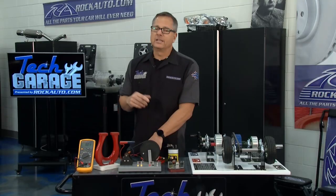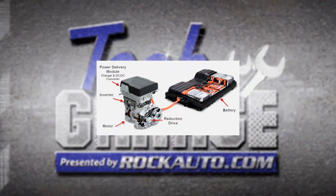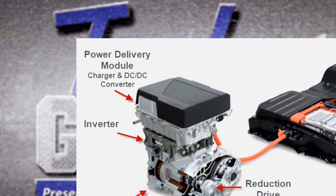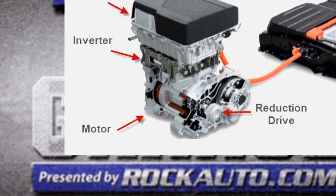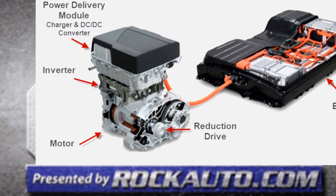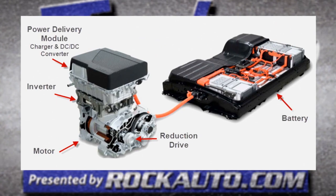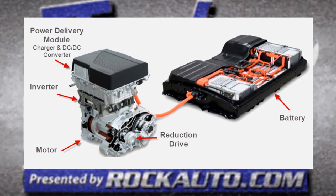Now on our LEAF, it's full electric — and what does that mean? You can see it right here on the graphic. We have a power delivery module on top with a DC charger and a DC-DC converter. We have the charging system up on top, below that we have an inverter, and on the bottom is the whole traction motor. All that stuff creates heat — that's a problem. So we have a low-pressure radiator system at about 130 degrees. That thing comes on, the pumps start cooling that system. If that doesn't cool, we have problems.